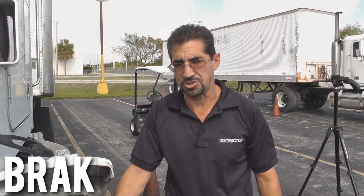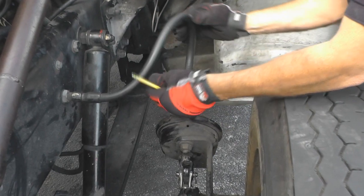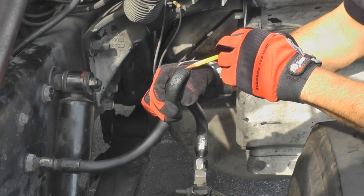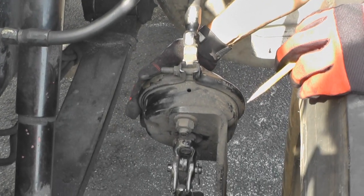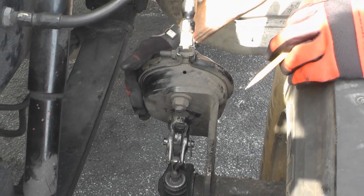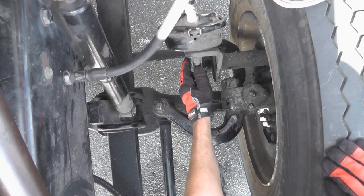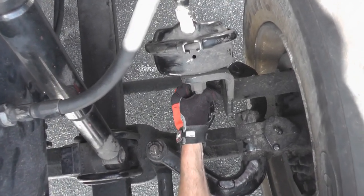The next system we're going to work on is our brake system. I'm checking my air hose — I want to make sure it's not leaking, no cracks, frays, or bulges. If I bend this hose, I can see there are plenty of cracks, which is not acceptable with DOT. I want to check my service brake chamber — when air is applied, it should not be leaking, with no cracks, no severe dents, and it's properly mounted. I'm going to check my slack adjuster and pushrod — the slack adjuster cannot pull more than one inch.